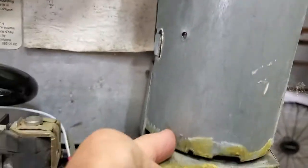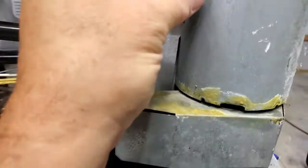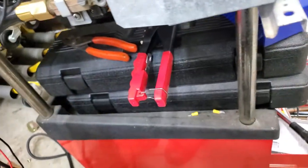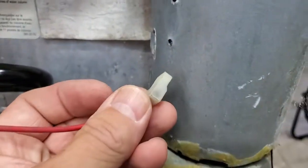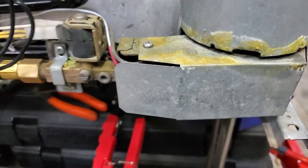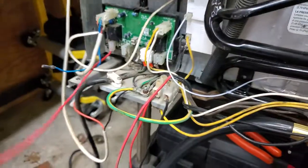It goes right about here, so if you measure this it's about four inches. You can do this on Norcold too. What this does — it gets pop riveted there. B-plus comes in from the coach or the RV, chassis batteries, or comes out, goes here, goes into one of these, and then the other one goes straight to the board — 12-volt power supply.